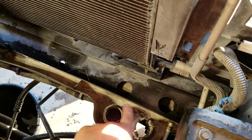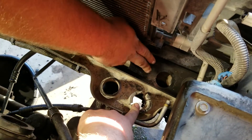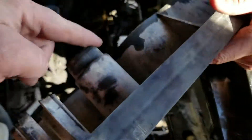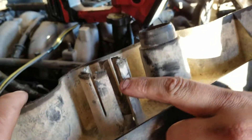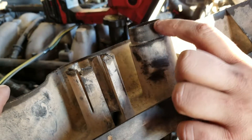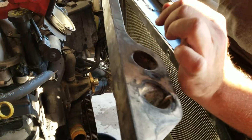These two — this one just fits in the hole and this one would actually snap in to secure it if this one was over here. For what we had to do, these inside ones match up with the inside holes on the lower crossmember. It's just those outside ones that are too far out. So you can either re-drill your core support, or you can just trim this hole — this insert — flush, and have this one stick in. With the radiator pushing on top and bolting it in, this will not move because it can't go back, it can't go forward, and it's locked side to side.